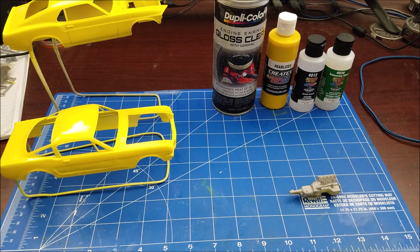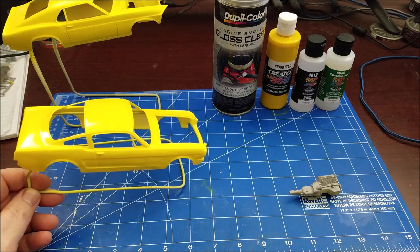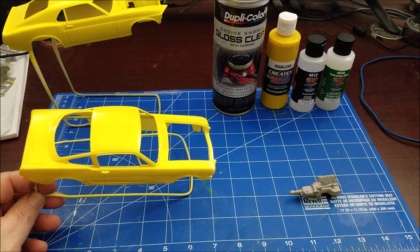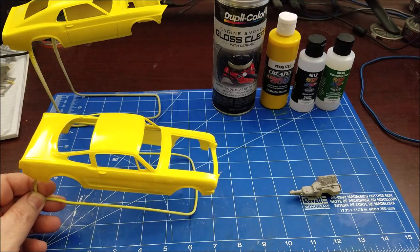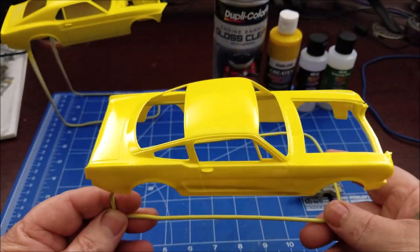One thing I found: I needed to open the gun tip up and turn the air pressure down from the recommendation — not quite as low as I run my craft acrylics, but lower than they suggested. I opened the tip up and got a good spray. This first Mustang was my test car since I'd never sprayed this paint before. I tested different tip settings — closing it down, opening it up — until I got it where I wanted it, then mixed paint for the whole job and shot the other one right after.